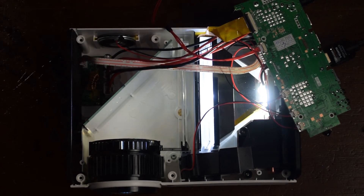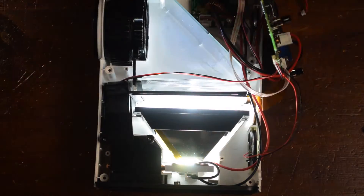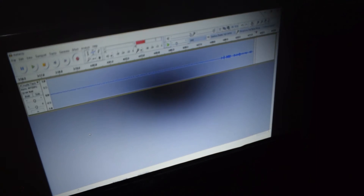Alright, so we got that part — I can kind of see it's not quite right there. So there it is up on the screen there, but if I were to take this and reverse — see, there it is without the polarizer. Now you see nothing. Polarizer back in backwards and you have this yellowish tint. So flip it over, and it looks the way it should, except there's this black spot in the middle for some reason. I'm not sure what's going on there — probably just because it's not all lined up in there since I'm just kind of holding it. It looks like the LCD actually did not like the way something's focused there. Alright, let's get this back together and see how it works.